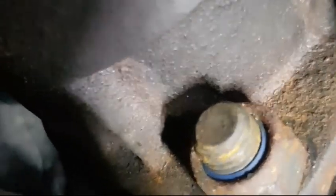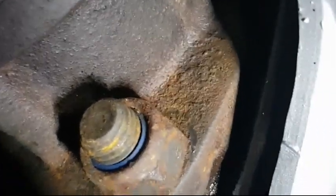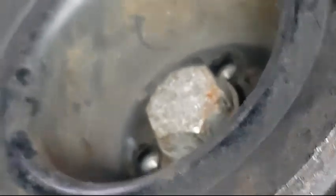Who knows when those last came out, so I'll potentially have to remove this exhaust cover protecting, and then get to the starter motor, because the tool is meant to fit into the same position as the starter motor, and fits within the cogs of the starter ring, which should hold in essence the flywheel stable without any movement. So when you put pressure on this bolt to undo it, the engine doesn't move internally at all. That's the idea.